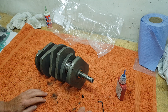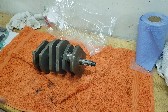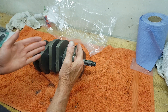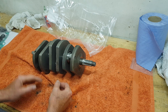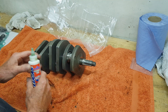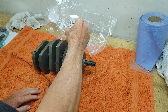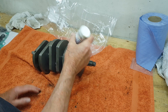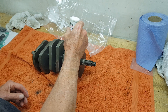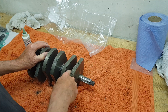I've put the plugs back into the oilway drillings so they're now sealed off. The oilways are clear so when oil comes up through the crank cases it should get good pressure and nice clean oil everywhere. All the journals are now beautifully clean and I'm going to put a little smear of assembly lube on each journal, just a light smear to protect them for now.